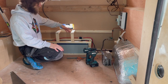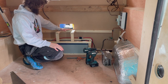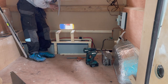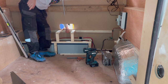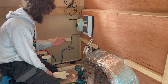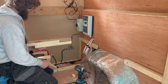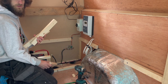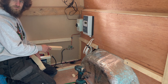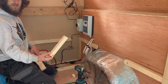I'm not going to bother putting a piece there - once the board is on it'll all be nice and solid anyway. That's going to be the support for the step, so there'll be a board that'll finish flush to the edge of that, and when you step through your foot will go on it and then you can step onto the bed. I've also knocked these three pieces of wood up to come across and create a boxing in - ready to be boarded - just to split the batteries and the gas. Also, these types of gases are a lot heavier than air, so you put vents in the floor and they should drop out if there are any leaks, because if it does leak you don't want it filling up and then going kaboom.